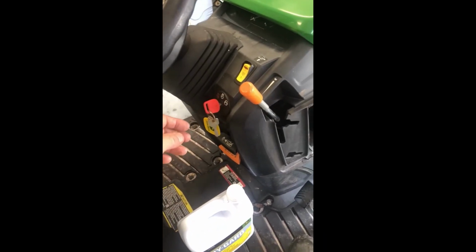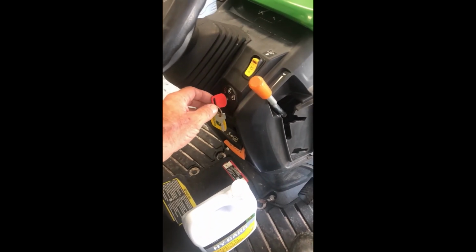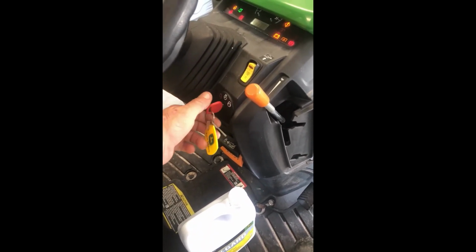But yet again, we still have a dry filter until we turn her on. So it's going to go down. So now that we're showing good at this point, now we're going to turn the machine on so we can fill the filter up, and then we'll have to add to compensate for that. So roughly 13 quarts are in right now, and being that we still got to fill the filter up, we're going to go ahead and turn her on.